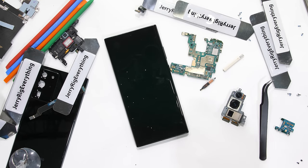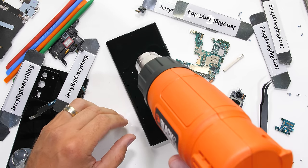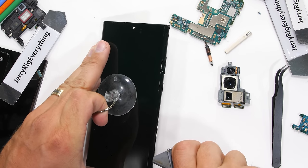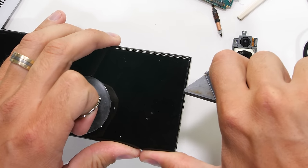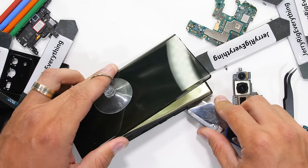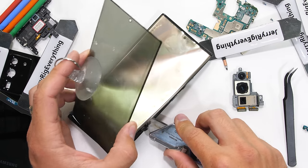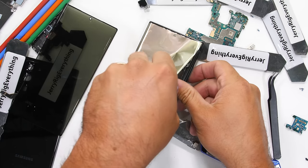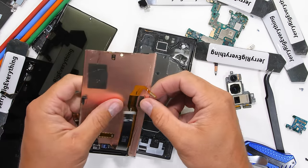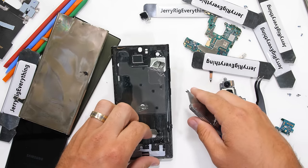Removing the screen kills the screen, so there's not really a need to be super gentle here — I'm just trying to avoid shattering the glass. The Victus glass is shatter resistant, so we shouldn't have any problems; it's the display underneath the glass that usually dies. This display is different from the ROG Phone 3 we took apart last week — it's made of a flexible material like we saw inside of the Galaxy Fold, and it doesn't crack or shatter. It turns out that copper we saw was just a large sticker for the screen. There's no vapor chamber to be found anywhere. It does have the ultrasonic fingerprint scanner down at the bottom.